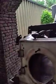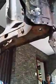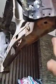So it's all lined up, and you can see on the top we have put an angle iron, and we have put 2 bolts and angle to secure it, so that there is no change in the dimensions, because these mounting points are very important here. I'll show you this one here. This is the mounting point, and the other side there. That is fixed onto the chassis. That is why these places are very important, and it must be secured properly.